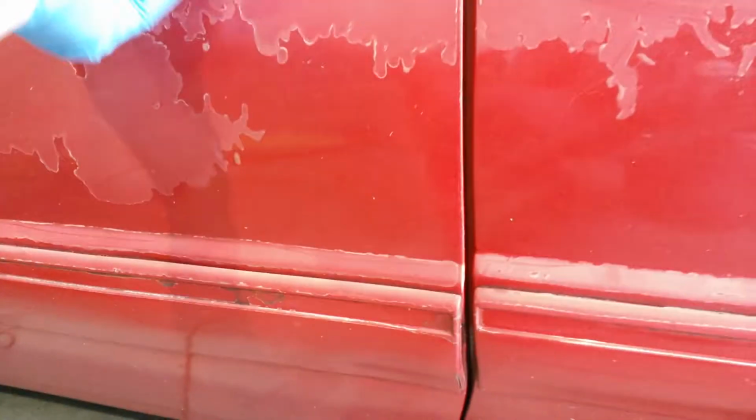So that's the sag on the door I'm talking about. What happens when this thing starts to sag down like that is, for one thing, it won't close that well. See, it almost has to lift up over the door strike to close. And this is where the problem starts, right here. I've replaced these pins a couple of times over the years of owning this thing.